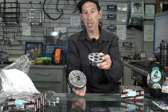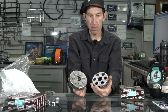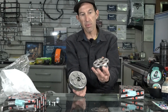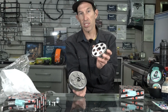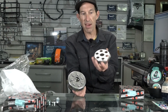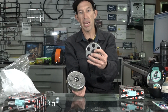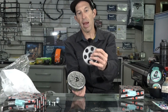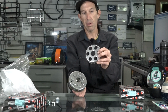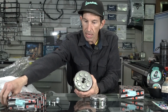But there is a reason sometimes you build up a motor with the cylinder kit and use a smaller clutch. A lot of the old race setups, before there was all these trick clutches out there, you would actually go to the smaller 125 clutch because it's just a lighter weight clutch in conjunction with heavier springs and a reinforced basket. You can see that's actually not ever original, this strap that's on here. This is available as a basket that's already made, or you could actually buy the band that goes around a clutch and weld it yourself to reinforce the basket.